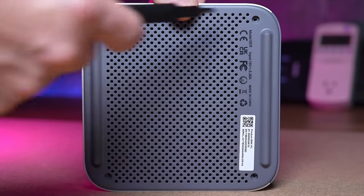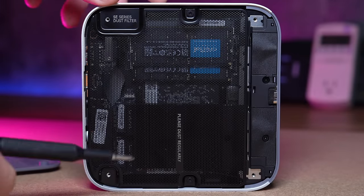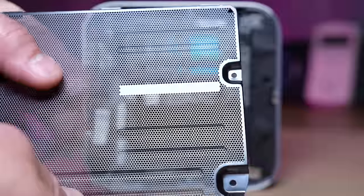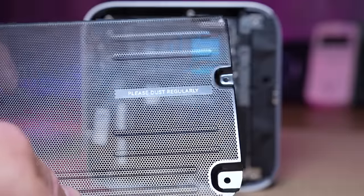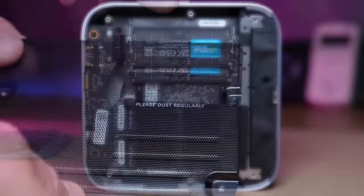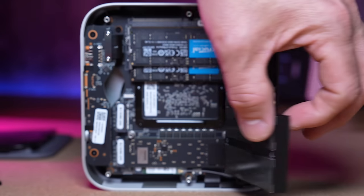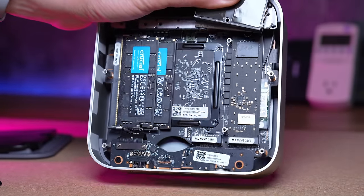The unit comes apart really easily — just four screws to remove on the bottom, and they give you a handy pull tab. There's a nice screen with two more screws, and then you can slide the cover out. I do like that it says 'please dust regularly.' Once inside, we have two Crucial DDR5 sticks and a heatsink covering the two NVMes. Once you remove the two screws, the heatsink flips over. If you tilt it on its side, it stays out of the way and you can get a good look inside the system.